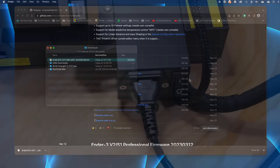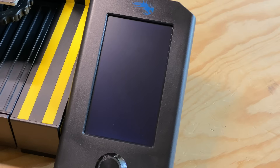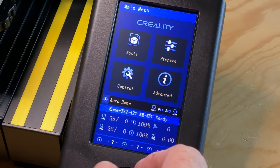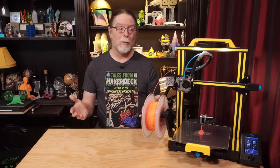Here's how to install the firmware. With the printer off, insert the card with the firmware file into the printer. Then turn the printer on. The screen will stay black for about 15 seconds while the printer is installing the firmware file, and when it's done, it'll boot to the main menu. Your previous firmware may have stored settings in a different area of memory, so it's a good idea to reset the settings to make sure the new firmware starts with known good settings. From the main menu, go to Control, then go to Restore Defaults. The printer will beep, and everything will be reset to standard values. And with that, you've got the firmware updated on the printer.